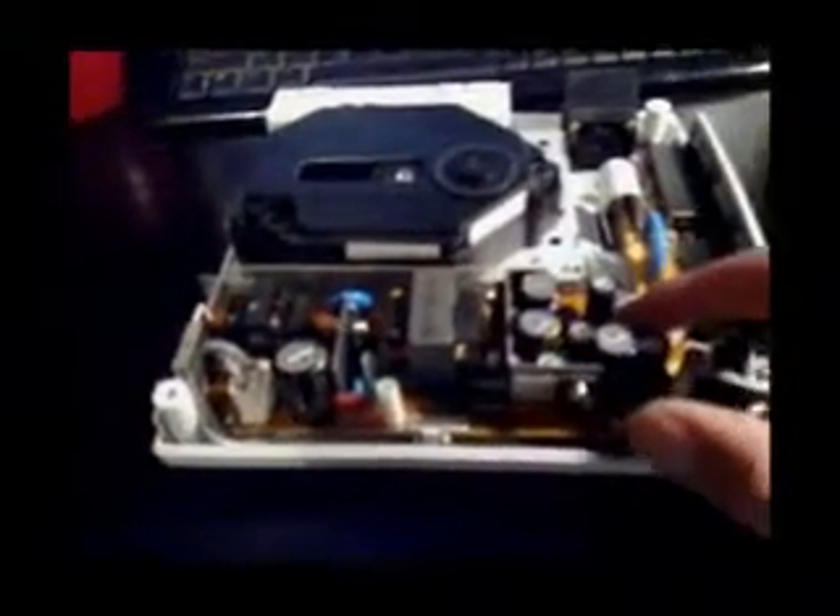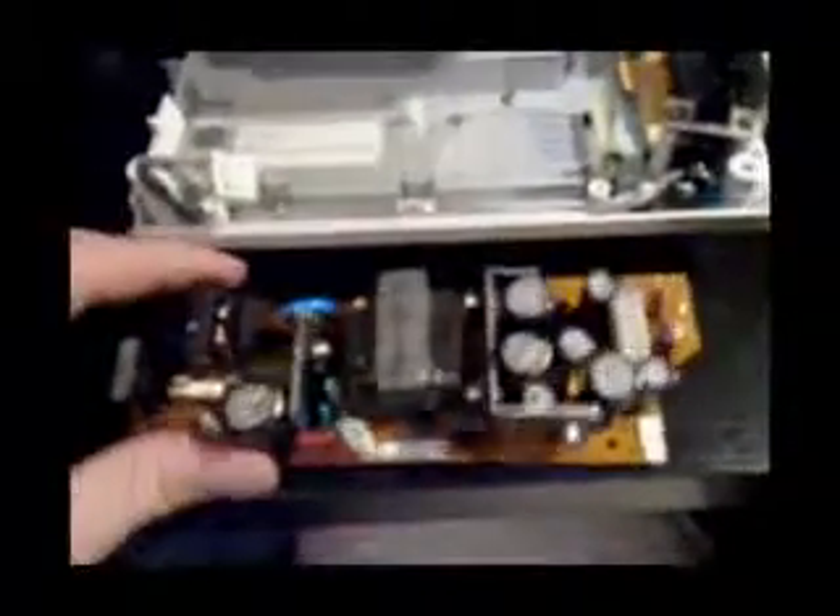Once the GD-ROM is out, there's a screw here, a screw here, screws along here, another one here, and a couple more here. This assembly all needs to come out as one. The first thing to do is remove the power supply because it's on top. The power board has been removed — just take note of that little connection there, you just pull it, it's a conventional push-pin connector.